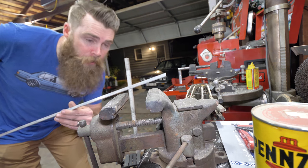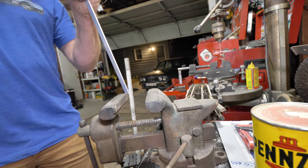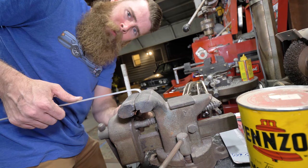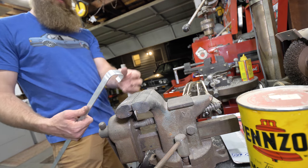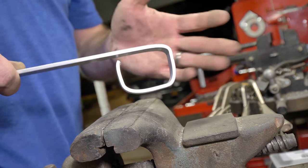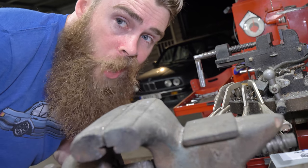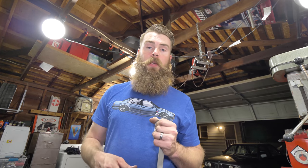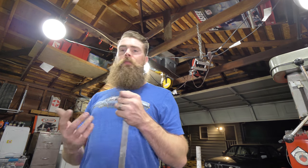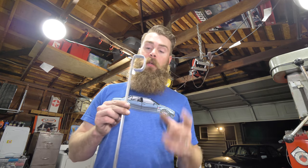So I just have a little stick of aluminum right here. What I'm going to do is go ahead and make a couple of bends — it's basically going to be kind of like a U shape. That's going to be my little spacer piece. If you had some box tube, that would be great, that would probably work way better. But this is all I have at the moment, which is basically why I'm calling this the free mod — it's just something I had laying around the garage. Obviously if you have something a little different, like some square tube, that'll work fine. All I have is round tube, some tube for roll cage stuff. I also have some flat plate. So this aluminum — lightweight, and it won't rust. I can just chop this off and put a screw through it, flush real quick.